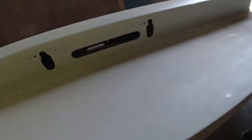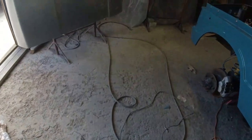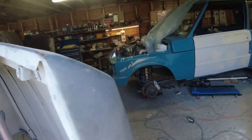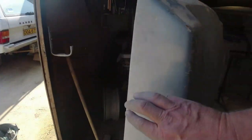Small skimmer filler, small skimmer filler. There's one down here somewhere there. Small skimmer filler. Bonnet, I've done the underside with a primer, so it's all been cleaned, primed. Again, block it back. And I've just started on the top side. Now this is the bonnet that came from the 1972 car that I sold, Alan. I'm not quite sure why I didn't use this one then, but the fact that I didn't is actually really good for Bob, because Bob gets a fantastic bonnet. There were some holes here that someone had drilled, so again, tiny bit of filler over the top of the welded-in plugs that I popped in there on each side. Well, once I've taken all the paint back and put a coat of primer on, I know exactly where they are.